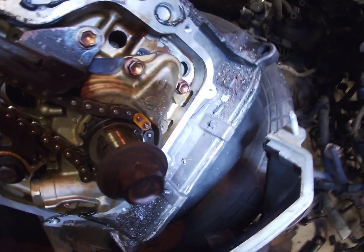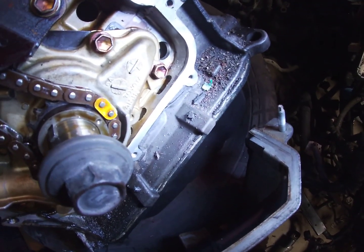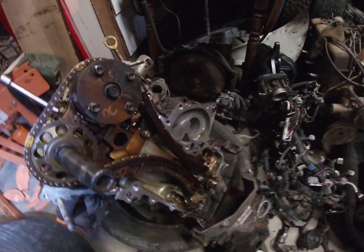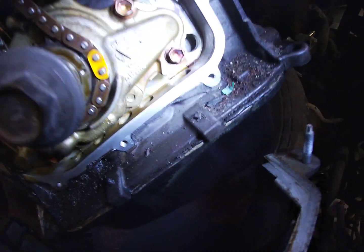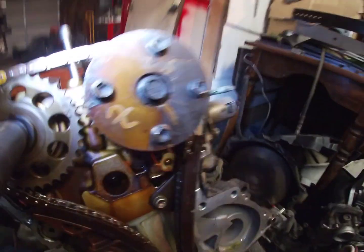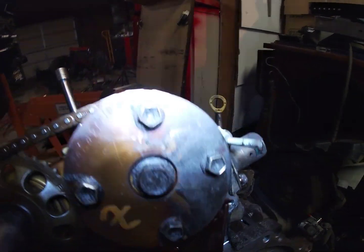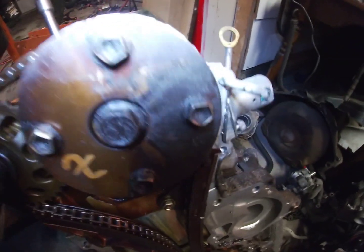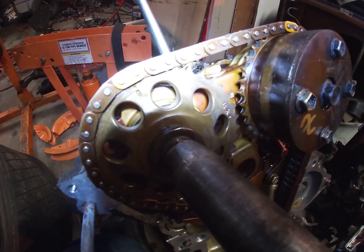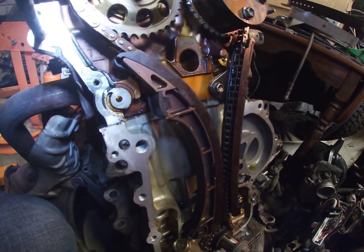Once you have it at top dead center on number one, basically that key is going to be almost straight up, and there is that little dot for the timing mark — the chain should have a different colored link for where it should be placed on that mark. The two marks that are closer together are for the cams, so place that one first. You have to slide the crank gear forward to be able to get the chain on. On the left side you have the exhaust there with the little dot, and that should line up with another little dot that's on the cam gear itself. There's also a dot right there below that bolt and a line — you want the line and the dot. There's a double dot on the left side where that one's going to line up. Once you have those three all in the correct spots, then you're in time, and you just got to put everything back together and you should be good to go.